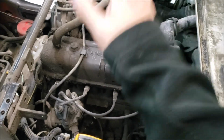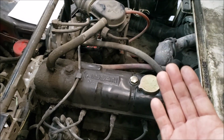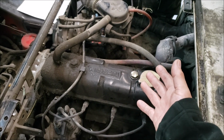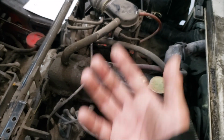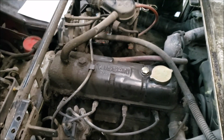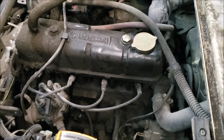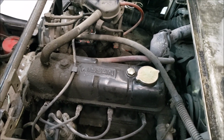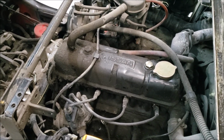So, at the end of the day, when the starter is not able to spin, it's a shorted wire from a positive to a negative. True? And what would that do? It is going to try to eat as much current as it can from the battery. And what is the battery going to do? Try to supply that current, but the voltage is going to drop. Does that make sense? So that was the first mistake. It's either that or something is wrong and it can't turn over.